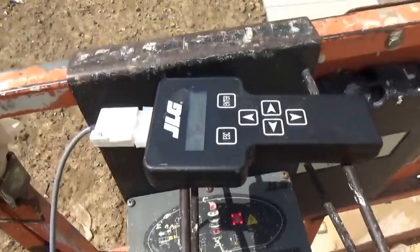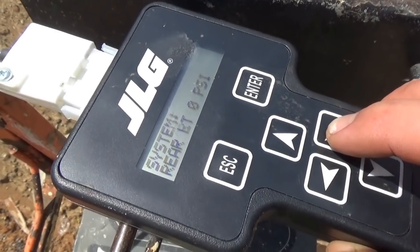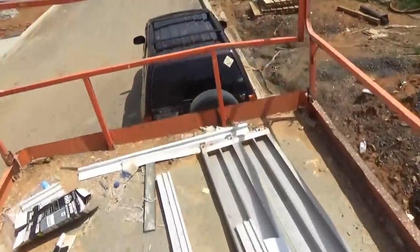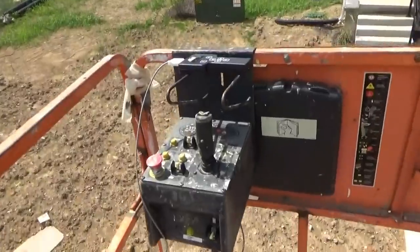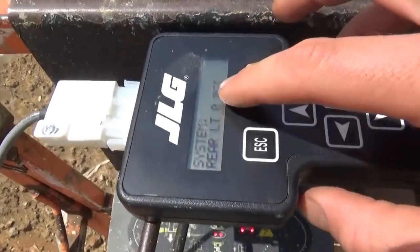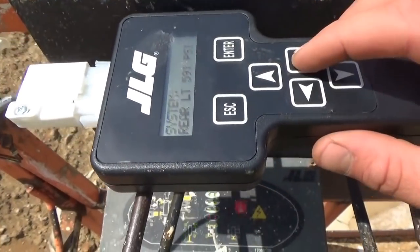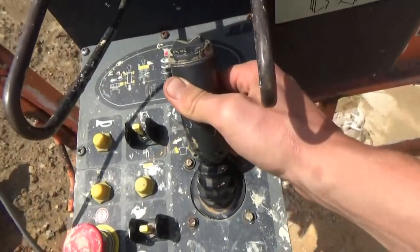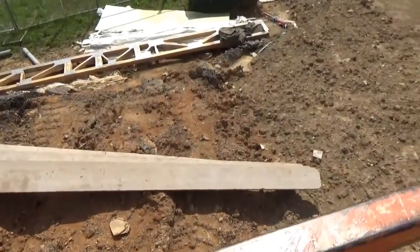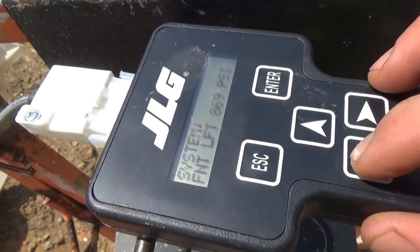We just touched the ground — there you go, front left at 41 psi. Let's compare all of them: rear left, rear right is at zero — so these might not have touched the ground yet. That's still elevated, this guy is still elevated. Let's keep lowering them until we see left rear go above zero psi. Okay, there we go — about 610 right rear, 650 rear left. Let's keep going. If you hold it, it should level itself automatically. As you can see we're tilting back — rear right 732, rear left 576, front left 869.